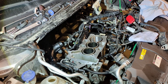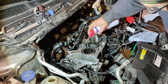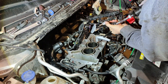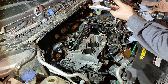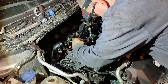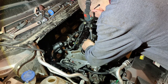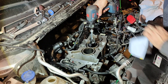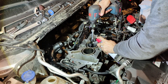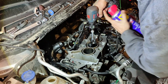Let's try again. So we got some WD-40. I'll spray the inside of the cylinder walls and we take the hone, compress it, so go in. We'll check for the depth — that's about the full depth I want to go. Take some more WD-40 and put it on a slower speed.